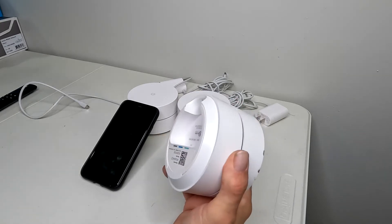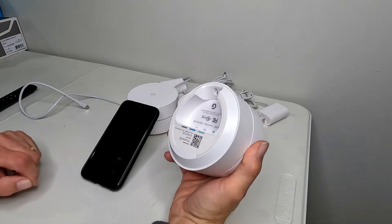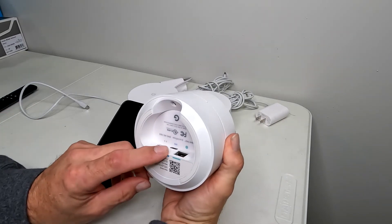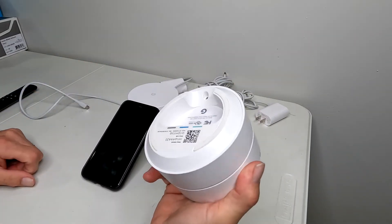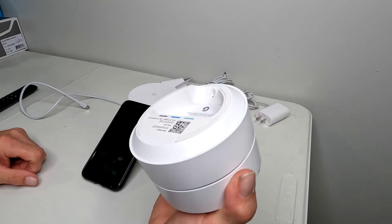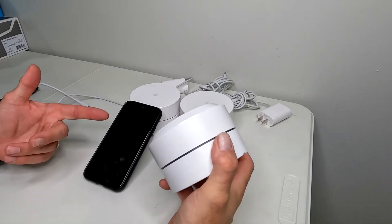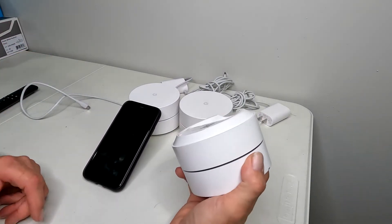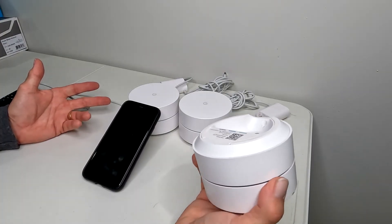Based on what I've seen online, it looks as simple as pulling the plug out of the back, pushing the button until the light turns blue, and letting go — and it's reset. What they don't tell you a lot of times is it takes up to 10 minutes for this thing to reset. So if you plug it in, push the button, go to the app and it still shows your old network or somebody else's network, don't get frustrated and try it again and again — you'll end up throwing them away or switching to a different mesh network.